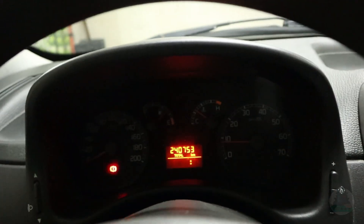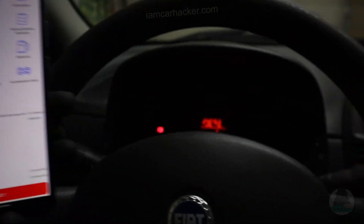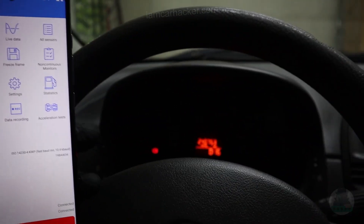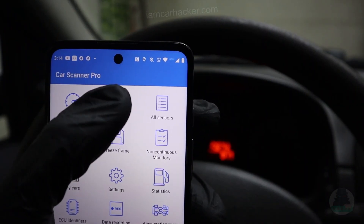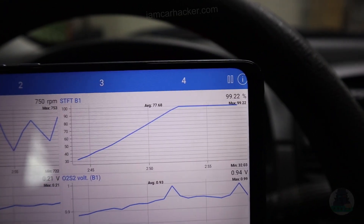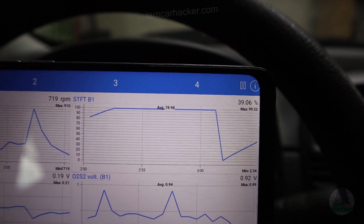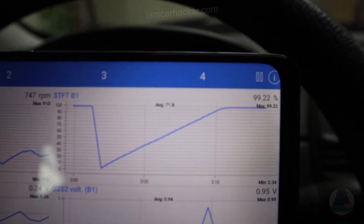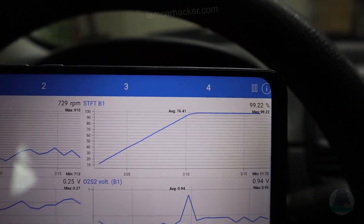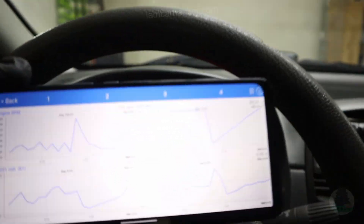Now this car is running a little rough. It works fine when I press the gas pedal but when idling it doesn't seem very good — I think it's because of a vacuum leak. We can check the open live data, especially this data point: short-term fuel trim. On a healthy engine you should see maybe 5–10% maximum, not 70%. The ECU is adding 100% fuel, effectively doubling the fuel amount because there's a lot more air coming into the engine due to that vacuum leak.